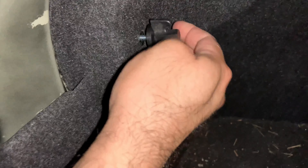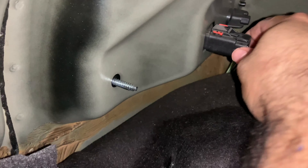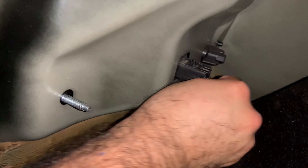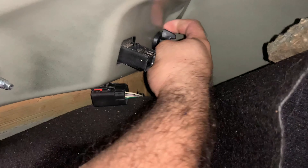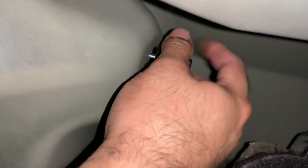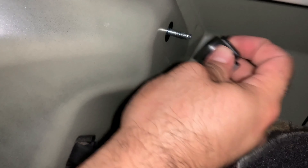So basically what I'm going to be doing is taking these off — you see this right here, that's one, we're going to take this one off first. Back there you'll have to disconnect this as well. This one has a little red thing, you just kind of snap it backwards and now it should be able to come off. Now we go ahead and unscrew this part right here, and there's another one up here. Once you get all these unscrewed you should be able to take off the taillight assembly.